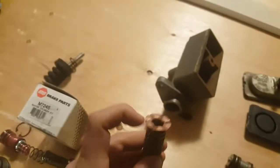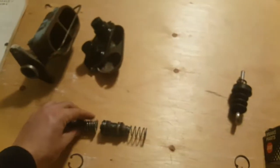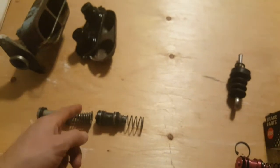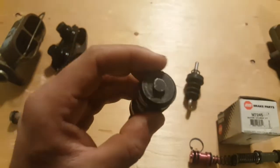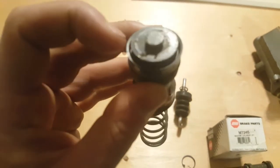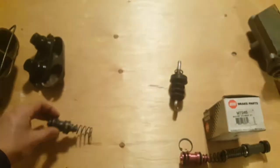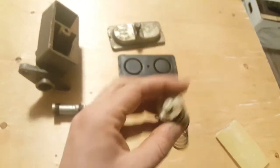One important difference that I noticed is in the material. This one is actually copper. And that one, this end part here is steel. So this one would rust, this one wouldn't. Somebody has tampered with this one because, as you can see, the end of it is all corroded. And so that tells me that somebody played around with that. And this one is just nice and round, as you can see there.